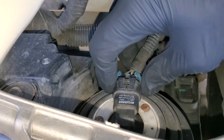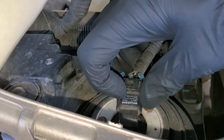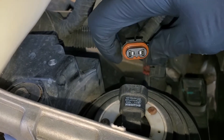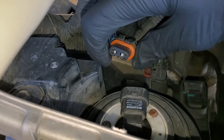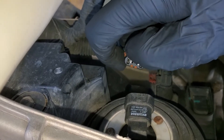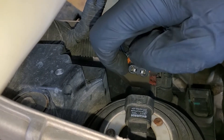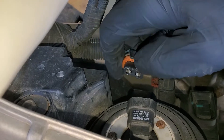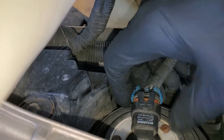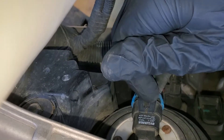As far as disconnecting it, you can see these little plastic tabs — you just pry them up and away from the bulb and it will pop right out. Do take care to inspect the pins, make sure they're not corroded or burnt out. I have seen many times where the bulb itself will be okay, sometimes even the bulb is new, but it made a bad connection at the pins, which caused them to burn out. And if that's what happened to you, you may need a new pigtail.